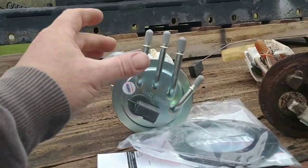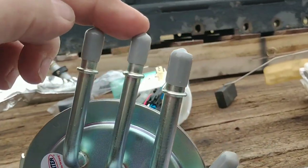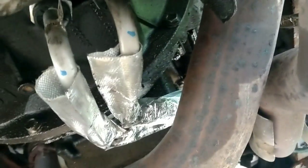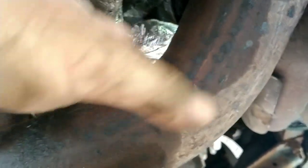I'm going to make my own fuel lines for this. This was pressure and this was return — I'll double check that. Transmission lines go in there with a holder right there on the oil pan — you've got to make sure you get that in there. I've got my new fittings in and got my lines in. Make sure that foil protection right by the exhaust didn't move. We want to keep the temperature down on these transmission lines — it wouldn't even be a bad idea to put a metal shield here on the exhaust.